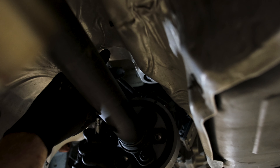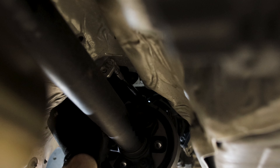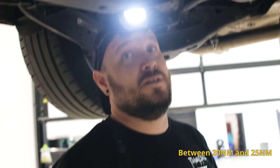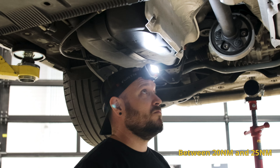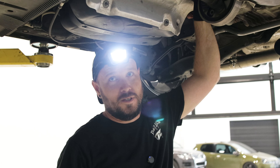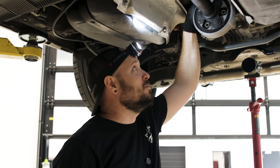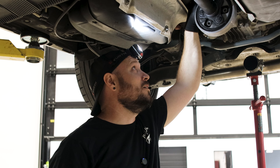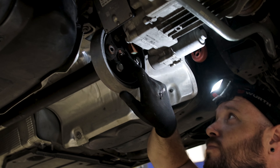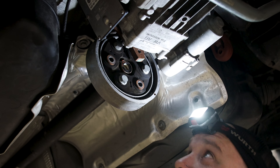So now the new spring is installed — we can put this back in the unit inside the car. We'll put this back up in the Haldex unit in the rear diff here. It's not super tight, it's snug and then a little bit more. You can gauge that by how tight it was when you undid it, and when I undid it, it just came undone — so snug, but not too tight. One thing to note: you might be wondering, I didn't put any sealant on that or anything. There are a couple of O-rings on the fitting, so when you're handling it just be cautious not to damage the O-rings, because technically Volkswagen says this isn't a serviceable part. They don't sell replacement O-rings, so if you need to replace one because it got damaged you'll have to find one that fits on your own.